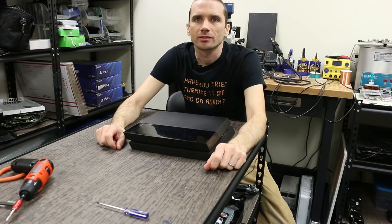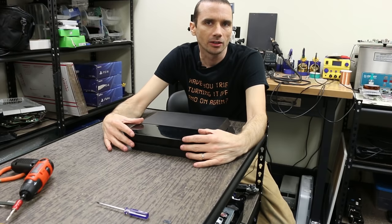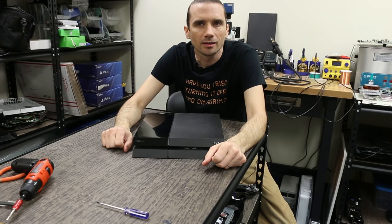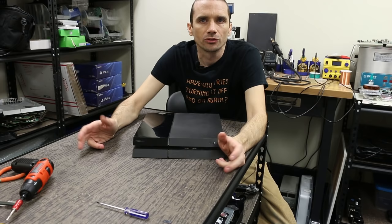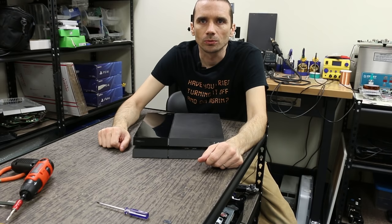Thanks for watching my video on how to fix an optical drive that won't play discs. Keep in mind there could be other problems as well — it could be a problem with the laser or a connector or something like that. This isn't to guarantee that this fix will work for yours, but one of the ways you can usually tell is if you flip your console and hear something rolling around in there, a lot of times it's that little white piece. So keep in mind this fix may not fix your specific problem, but it'll fix a lot of them. Usually the two things are a laser replacement, or it needs those rollers or the white connector bar replaced. If you have questions or want to send it in for repairs, we're happy to do that. You can also chat on our website, text us, call us, or ask questions in the comments. Thanks for watching and have a great day!